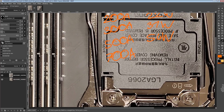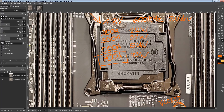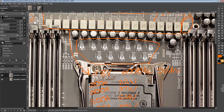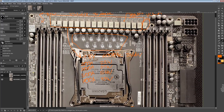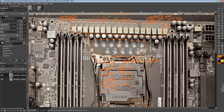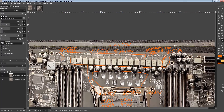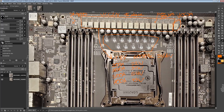Going up to 700 amps — which is just more for fun than any practical purpose — the VRM would produce about 93 watts of heat. By then the VRM water cooling might actually be useful, but there's no way you're getting an X299 CPU to actually pull this much current. From what I've seen, the upper limits of what people have pushed into X299 is around 1200 watts going into the power connectors. This VRM, for the intended purpose of this motherboard — water cooling — is really overkill. It's a real shame that it's kind of restricted to a motherboard that only comes with a water block.